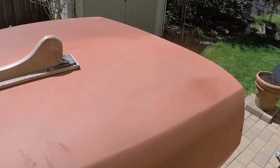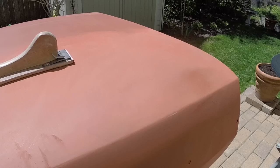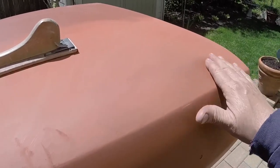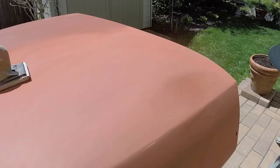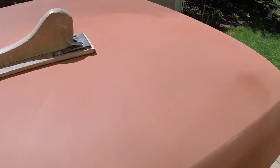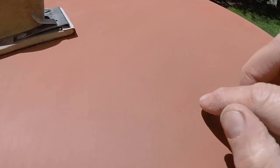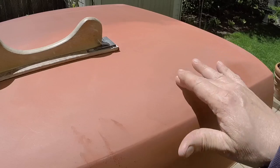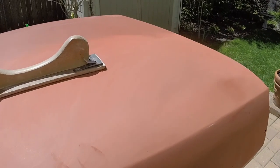This primer, I can just spot in it — it's really easy to use stuff, it's lacquer base, dries as fast as it comes out of the gun. That just kind of gives you a picture of what I do so you don't see things like that. All these little marks from grinders — that stuff will show up in your paint if they're visible, sanded in the primer. They'll show up in the paint.